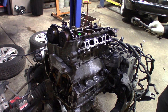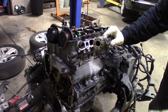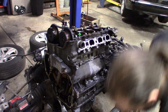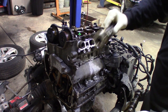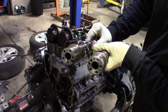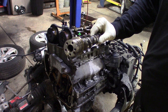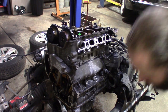You can see the notch is down there on this one, and for this one the notch is also down there — but the line-up is the same. You can see the notch is 180 degrees off — that's the difference. And the same goes for the phaser. So this is the cam we're going to need.